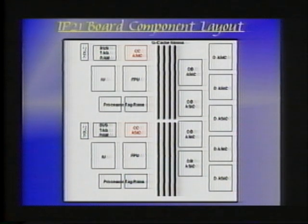The CC has been redesigned due to different data path into the data cache and the type of data that the GCache holds. CC means cache controller, whereas it used to mean cache coherency. The tag RAMs contain the cache line management bits, and the EPROM contains the microcode for the power on tests.